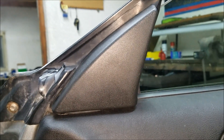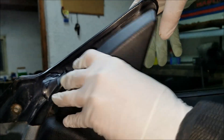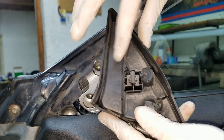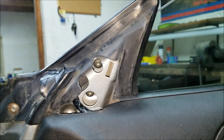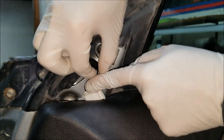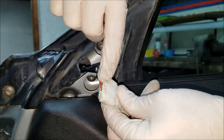If you want to remove the door mirror altogether, we got to start with this piece of plastic — all we got to do is pull it off. It's held in place with this metal clip. Next, move on to the connector: pull it out and press on the little plastic tab to undo it.